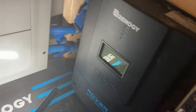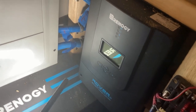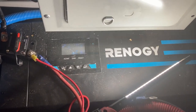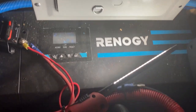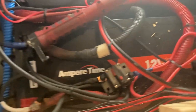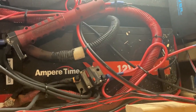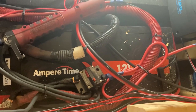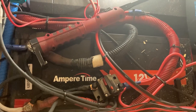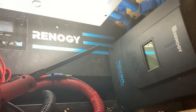And then this is our solar charger — it's a 60 amp solar charger. We don't have solar panels yet, but it is wired for solar and we have the box on the roof with all the wiring going through the walls. And then here's the main power plant, which is a Renogy 3500 watt smart charger — we have been extremely happy with it so far. The goal is to expand to possibly another 300 amp hour battery, just because we did run so much on the camper off of 120 volts. If I were to do it over again I think we would use more 12 volt stuff like a fridge and a hot water heater. But it has served its purpose. We just have to charge it back up with the generator, and hopefully once we get solar and run it off that solar charger, that should help us out quite a bit.